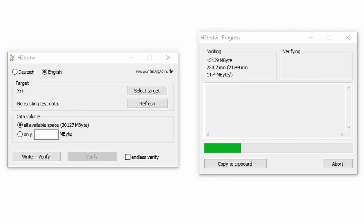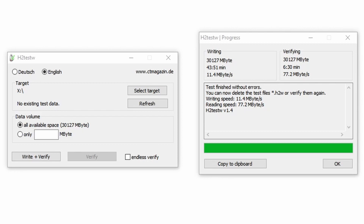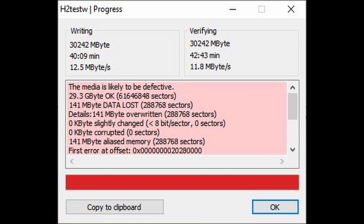The speed shown here is the average writing speed and average reading speed — the average of writing the card fully with data and then reading all of it back. If the software gives an error during reading, it means the memory card is faulty or fake. If fake, the whole card can be written but during reading only the first two, four, or eight gigabytes can be read — basically a two, four, or eight gigabyte card expanded virtually to 32GB or whatever is written on the label. If the reading procedure finishes without errors, the memory card is working.